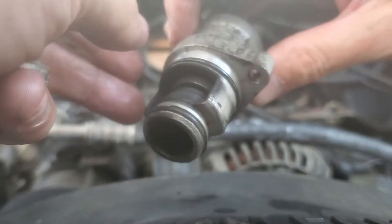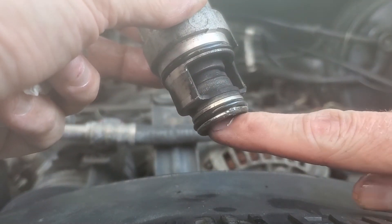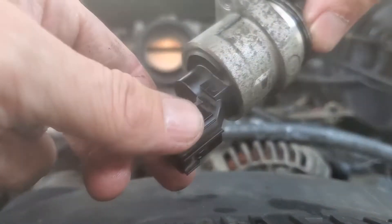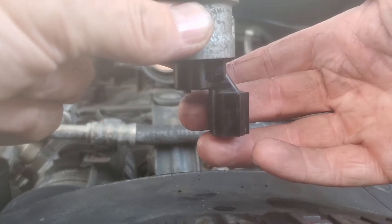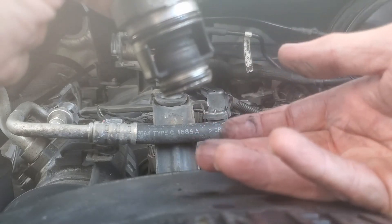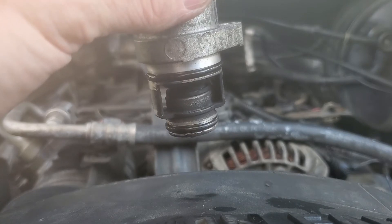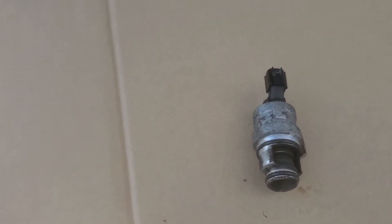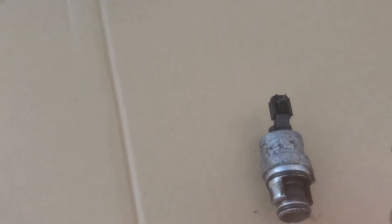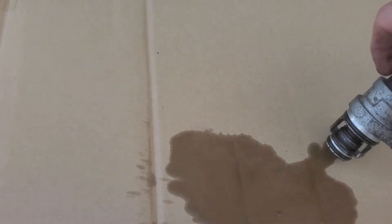If you're going to clean this up, make sure you hold it this way and spray into it in here — especially in here. Because this is electronic, you don't want to hold it down this way and have spray going in there; you want to make sure you're spraying in here and allowing the liquid to drip down. I'll take my intake cleaner and clean this whole thing up. I don't want to get any liquid on the electronic part, so I'll just clean over here. You can already see the carbon and deposits that were on there coming off.